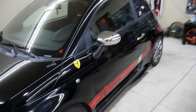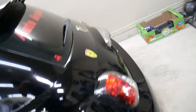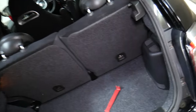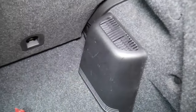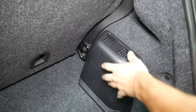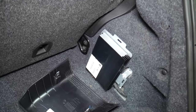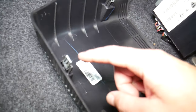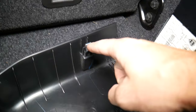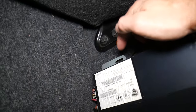So where is the sound amplifier located? If you come toward the back, you're going to open the trunk on your Fiat 500. Right here you have that cover. We're going to get a panel remover tool and pull that thing out — it has three spring-loaded clips attaching it. They go here, here, and over there.